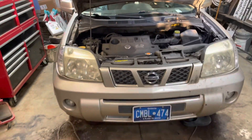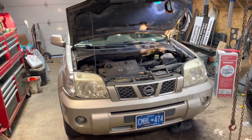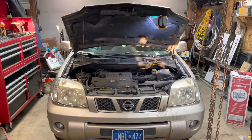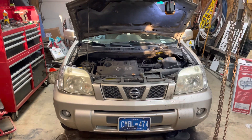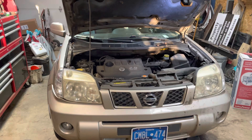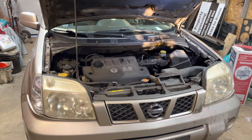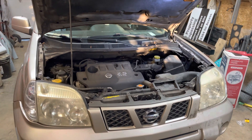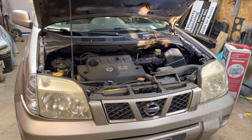Just want to talk about it first. If you want to skip ahead to me actually doing it, that's fine. Some symptoms of why it could be failing: basically for us, you'd be driving down the road and it would quickly stall and then start again within about a second. Sometimes after driving for a bit — and it's also summer so there are hot days — you'd park it and then it wouldn't start or it would be hard to start. And obviously you get the check engine light, and I was getting the code for the crankshaft position sensor.